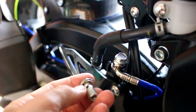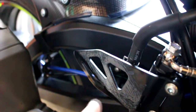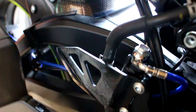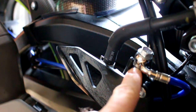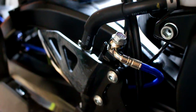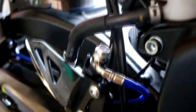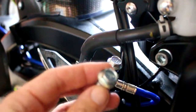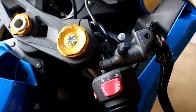The Galfer kit comes with washers - they're going to be copper or brass, I think brass. You put the banjo in there with a washer underneath first, then you put the washer on top of the rear master cylinder - that's the first thing. Then put your banjo, your end of your brake line, on there. Take your banjo bolt which has a washer up against the head and push it through. Screw it in by hand until it starts taking the thread. That's how simple that is - it's installed.